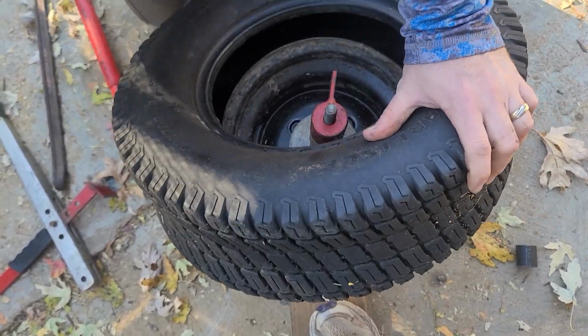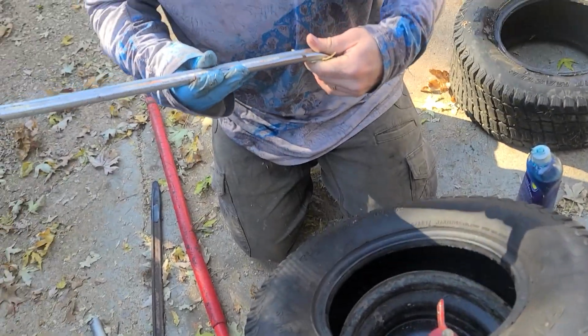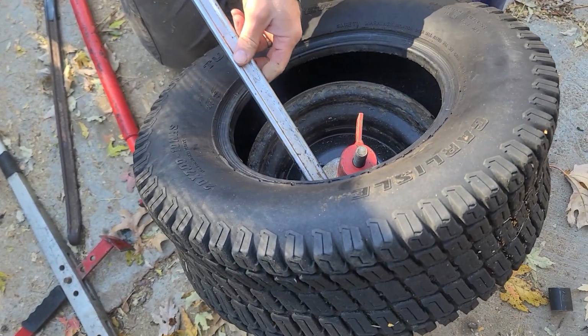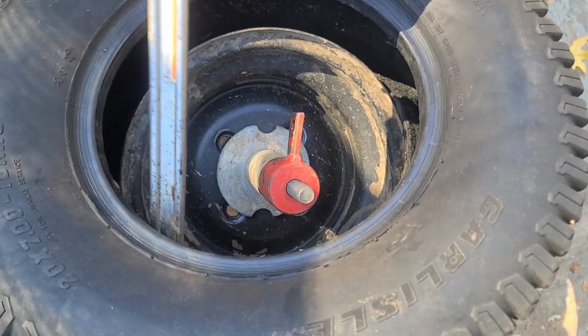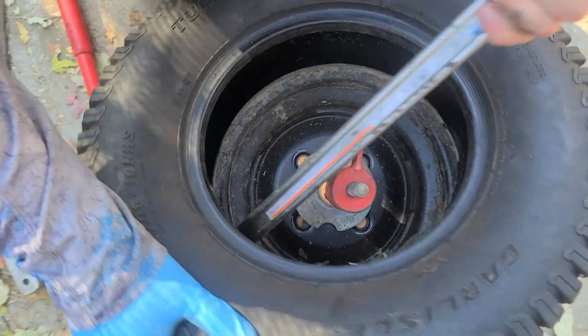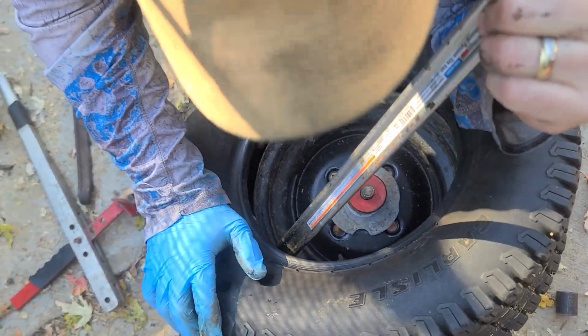If not, what you're gonna do is grab your thinner one. This is a Harbor Freight tool as well. It is the Pittsburgh 24-inch general purpose tire iron. I'll find the one that's on Amazon and link it to you as well. What I found is go like this, grab this under there, and you get under like this, look, and you go. And then you push down after you have it propped a little, and it will force it over the rim while you hold with your elbow.